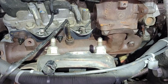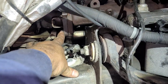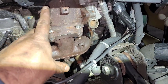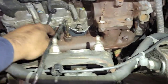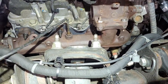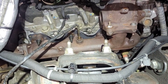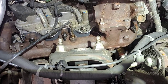I got all three of the flange bolts tightened up. I was really happy to see that this one tightened up because it was the one I had issues with — it went back together and tightened up. The EGR is on and tight. I've not torqued the manifold bolts yet, and I have not found this metal shim that goes in here. I called Lynn Layton Chevrolet in Decatur, Alabama — it was our closest one that was supposed to have it. Now they say they don't have it; they're going to keep looking and call me in the morning. I may wind up finding one off something else.